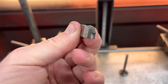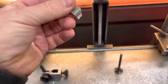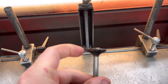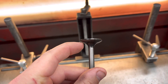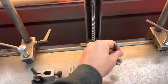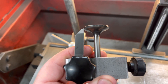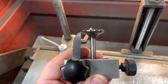To set this tool we use this setting piece. What I try to ensure is that the outside of the one-and-a-half mil 45-degree seat goes right to the very edge of the valve seat, so the seat is as far out on the edge as possible, and then you've got a nice inside 60-degree angle for a nice flow there in the valve. We put the valve in the setting piece and I've set that pointer right up at the outer edge of the 45-degree angle on that valve — that is where we want to be setting that cutter.